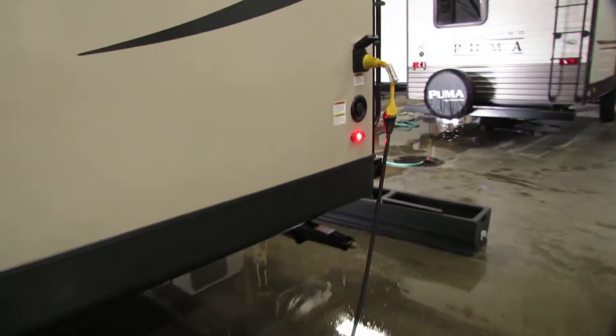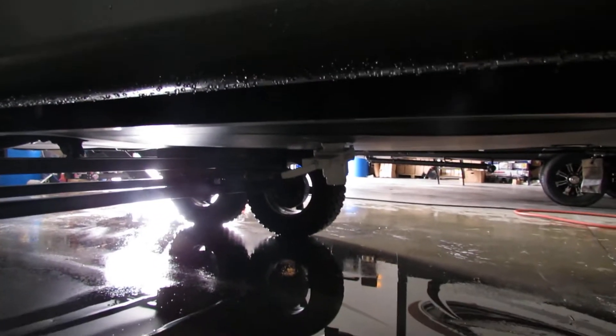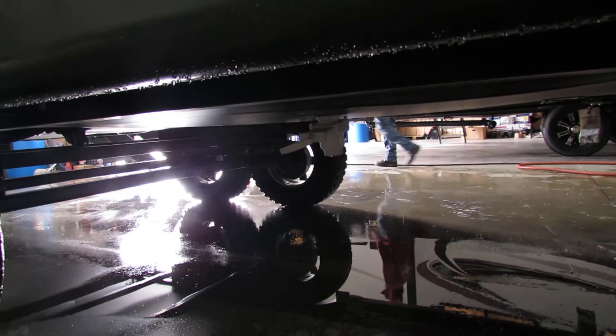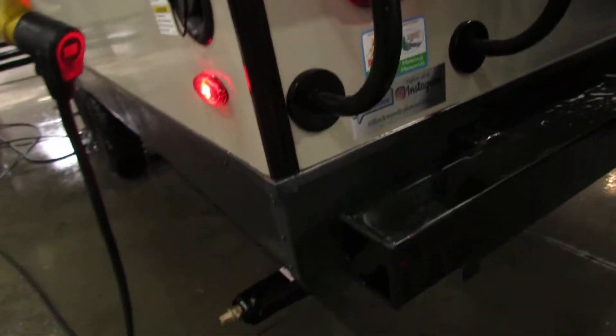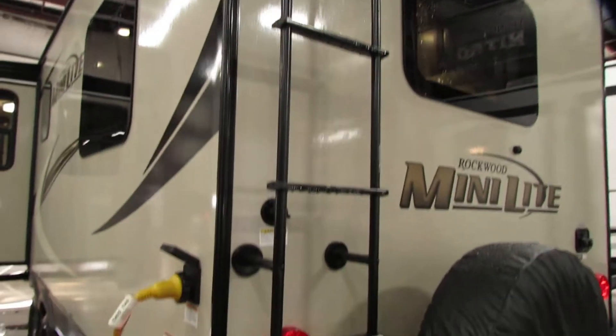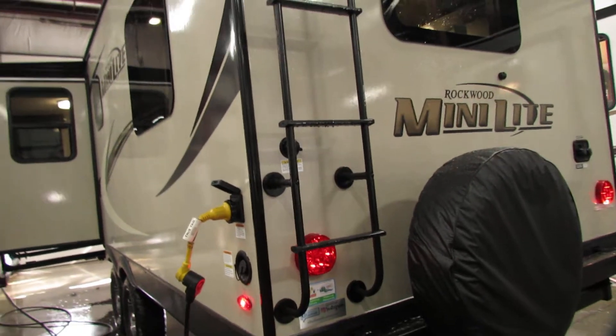Fresh water fill — fill that. I would leave this open; it's a quick-drop system. I go halfway with it just so it still gets air, doesn't get stagnant and moldy. Add a cap of bleach to that to kill bacteria. You can put your sewer hose in the bumper. Got the ladder to check the roof — always check your roof and your seals. They say every 90 days in the book; I say every trip.